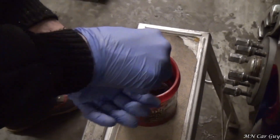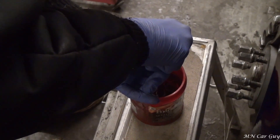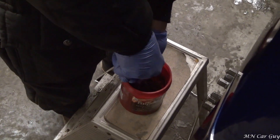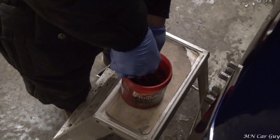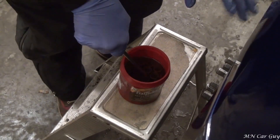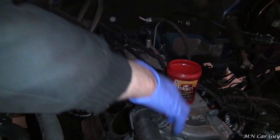Then you'll take one of your push rods and actuate the lifter, just pressing down on it with steady pressure. And once you feel it go down, release it and it will have oil go into its oil hole. What we're doing is pre-lubing the inside of the lifter so they're not going to be noisy when we start it up, because it takes a little while for the lifter to get oil in it. Although you have pre-lube on the outside to install it, that's not enough. We've already got one set of lifters in place — the tray's not bolted down yet, but we're close.